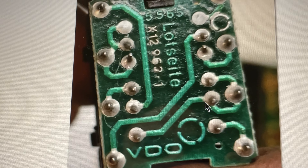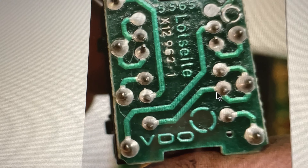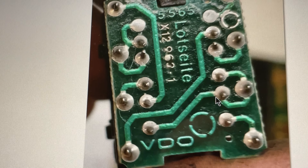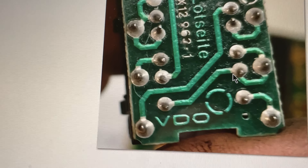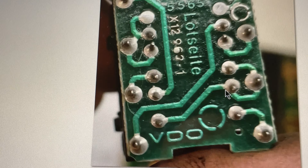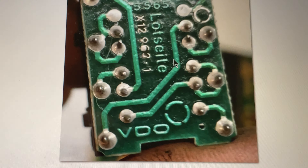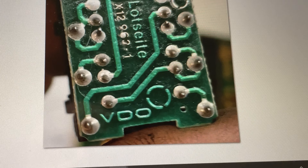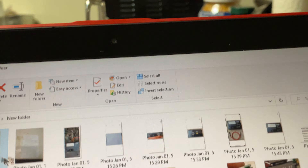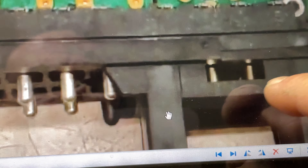The resistor values are: 3.3 kilohm, 0.1 ohm, 27 kilohm, 1.5 kilohm, and 500 kilohm. The way I measured those resistors is by removing the plug and testing them right on the circuit board. There's no simple way to test the plug in isolation because the resistors are connected in multiple cascaded positions — you have 256 combinations from the 8-bit bus with 8 pins.